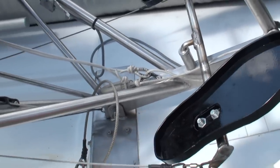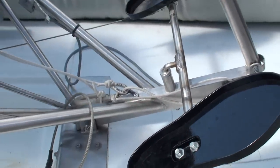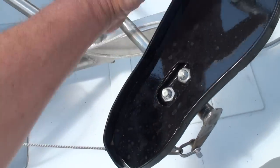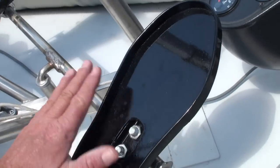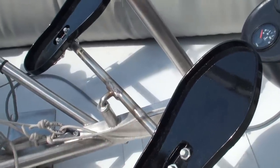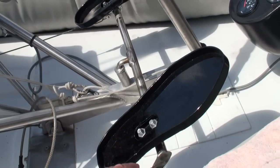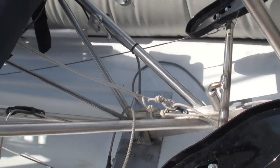I made some small modifications on this bar here where you put your feet, which controls the rudder. I've lengthened this and put a longer bar here — the original was just a much shorter bar, which had your feet in here, and when you turned all the way your toes were basically jamming into the center bar. It didn't have these; it was just a bar, a little too short. This is much smoother, just being able to rest your feet in there, and it gives you a little more torque on the bar so it steers a little easier.